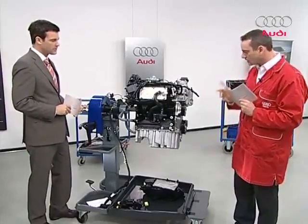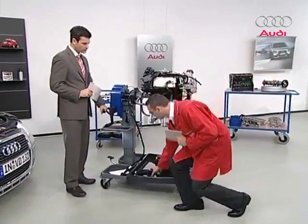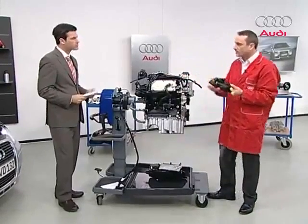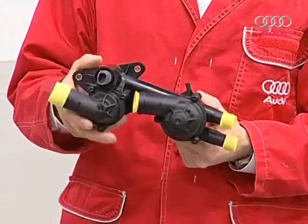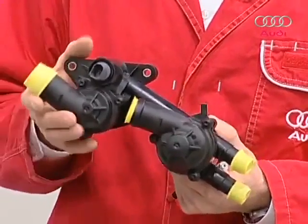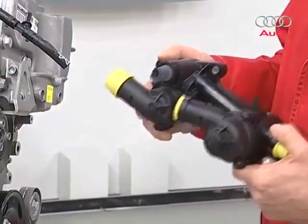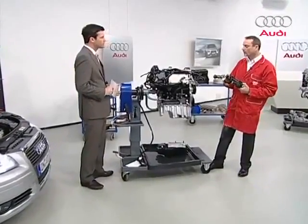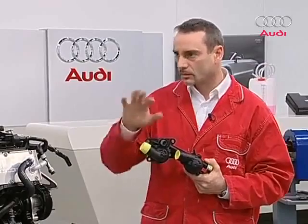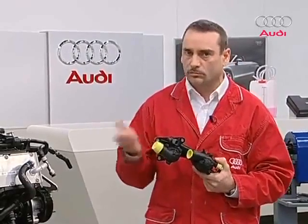Let's look at the two thermostats — also important components of our cooling system. We have two thermostats because we have divided up the primary cooling system: the head is cooled differently than the block, and that's why they differ in size. We want the block to reach a higher temperature, which reduces friction losses and makes it easier for the block to heat to operating temperature. And because the head is near the combustion chambers, we want to maintain a lower temperature to keep the engine from knocking and to improve volumetric efficiency, reducing emissions and increasing fuel efficiency.